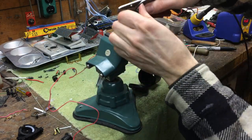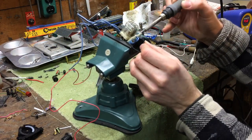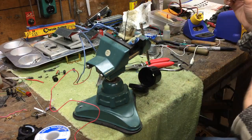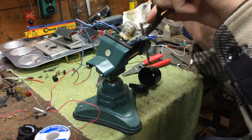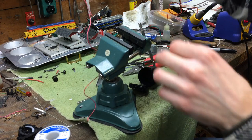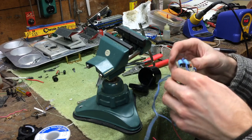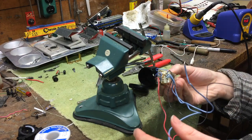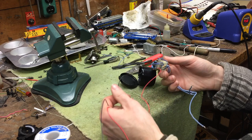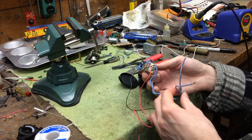The lamp is wired in series with the two blue wires, which are tied to the same 12-volt power supply. So now all we have is just the two wires to power the relay and then the two wires to trigger the light bulb. That's a whole lot simpler.